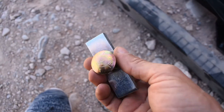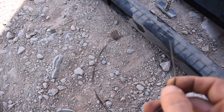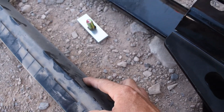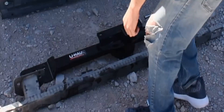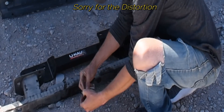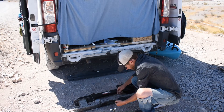The next step is to get your half-inch carriage bolts and the spacer — they include a fish wire for you. You're just going to unwind this and pass it through the large square holes in the front of your bumper assembly, and it'll pass through and pop out on the hole on the back side. That will in turn fish through the top of your new assembly. We've got this one fished through and we're just going to thread the bolt onto the end. Now let's get the other side.